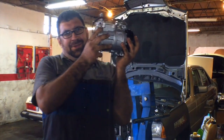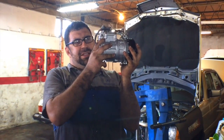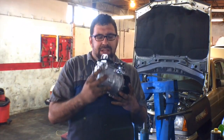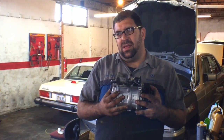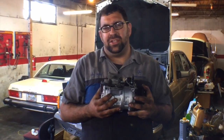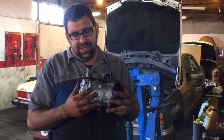Good afternoon. What I hold in my hand here today is a Mercedes Nippon Denso AC compressor. This compressor was used after 1986 in all models, and almost every 190 series used it, except for the very early 2.3 liter cars.